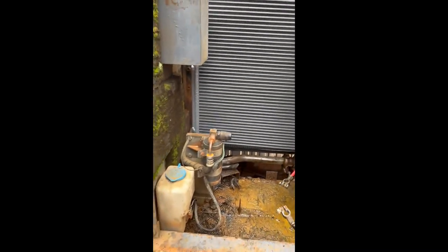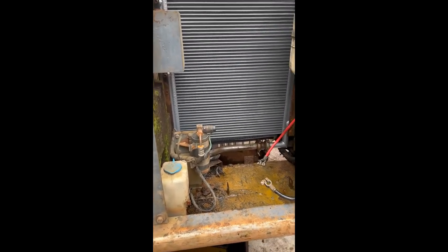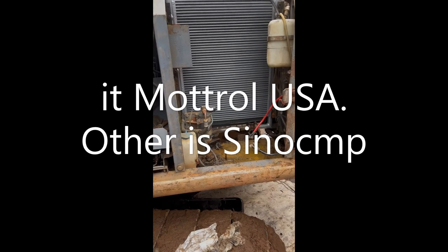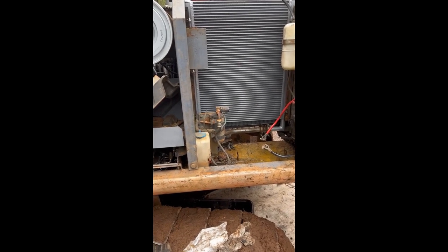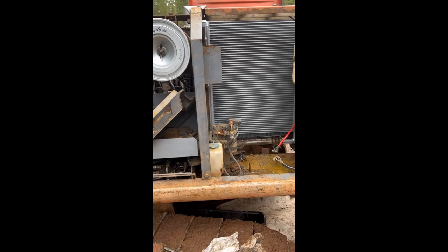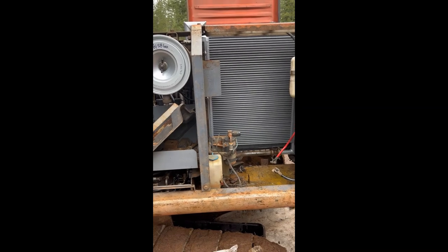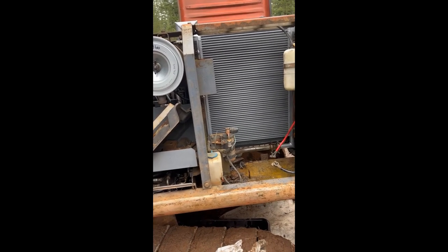I bought this cooler from a company I've used for several parts on this excavator — I use eBay, and there are other places like Amazon. The company I used was Motrol (M-O-T-R-O-L); I've also used Sinocomp in the past and they do pretty well — I think they carry the same products frankly. The rain held off and everything's sealed, so I can go have lunch. Overall this took three, maybe four hours of figuring it out. The big trick was loosening the radiator and allowing it to tip back. Thanks for watching, have a great day.